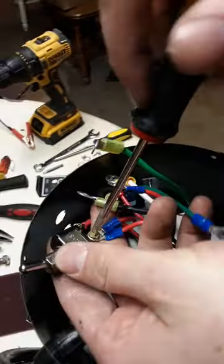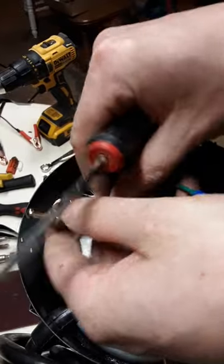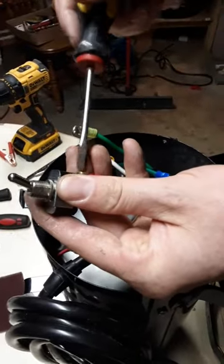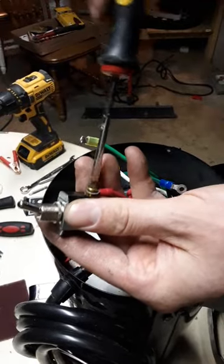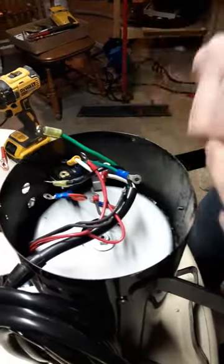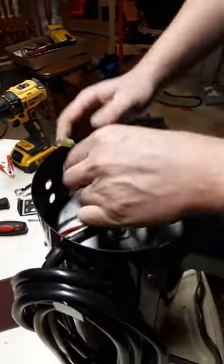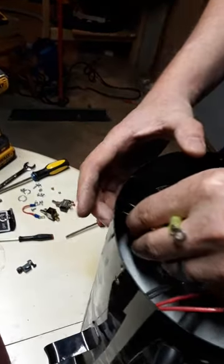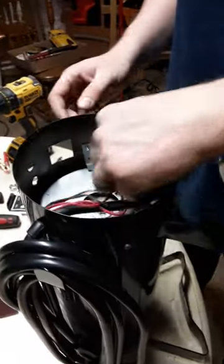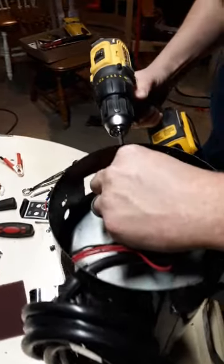Same with the other switch — two little screws. You really want to be careful not to drop these screws into the motor, because if they fall into that motor pan it's kind of a pain to get those out. For the outlet, there are two little metal pieces on the back — just squeeze those together and it'll pop right out. Then there are two motor stops in here that hold the motor from coming back; those use a square bit and just come right out.